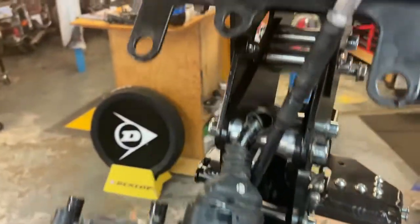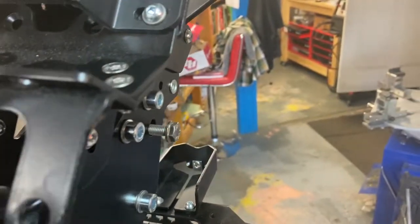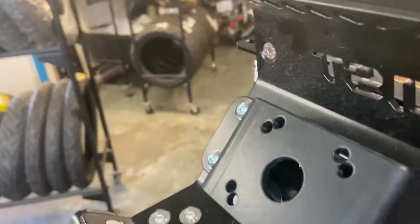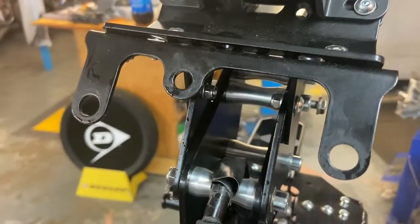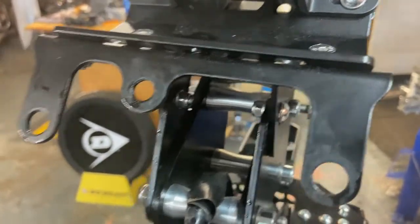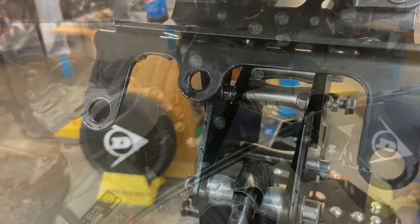Most people know about the grommet holes for the dash. Basically let me get the clutch cable out of there. That dash fits like that — as you can see, one of these things isn't like the other. So just a minor little thing: I actually have to go in and drill that third hole out to the correct size, and then we'll be able to get the dash in.